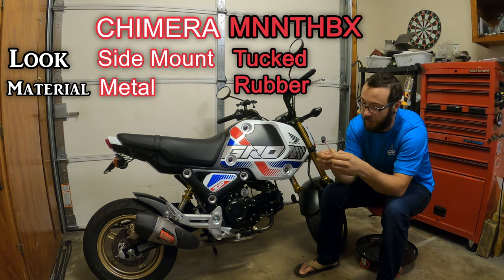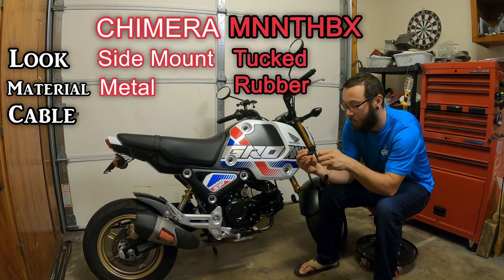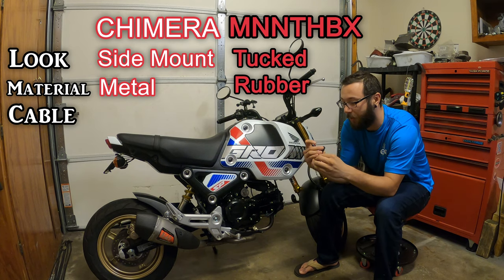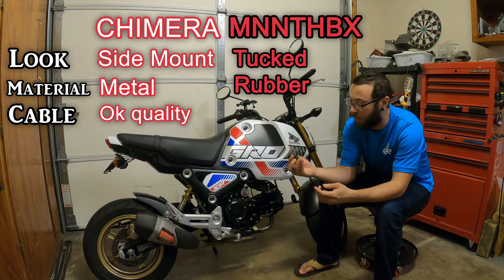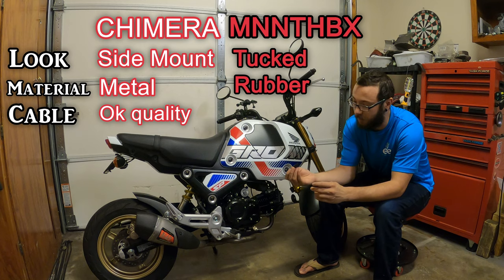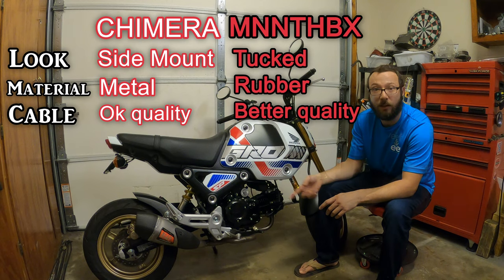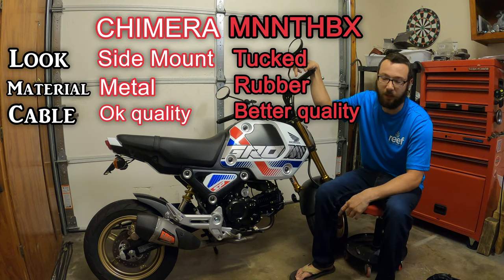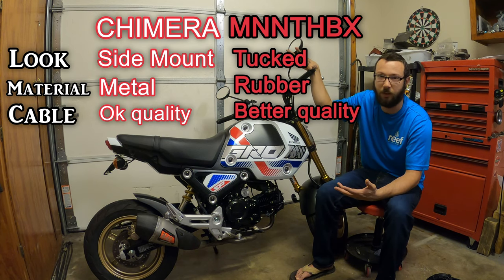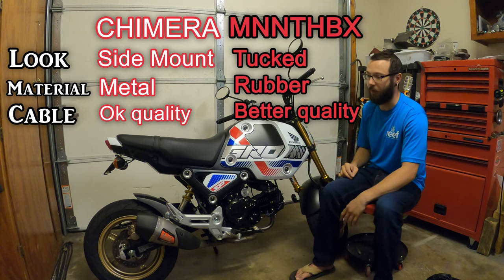This is the death of Chimera's setup here. This cable likes to just pop out, doesn't sit in the housing well. Everyone's noticed this at this point, so if you haven't bought a Grom yet, you probably don't know about it quite yet, but Chimera's extension isn't the best. It does work if you finagle it and get it housed correctly, but other than that, go with Mnnthbx. Anything you do a reset for, it'll give you the check engine light, and it's because that cable's not connected. So it'll start, it'll run, but you still get this code thrown. So fix that. Make sure that's seated if you're getting that error.